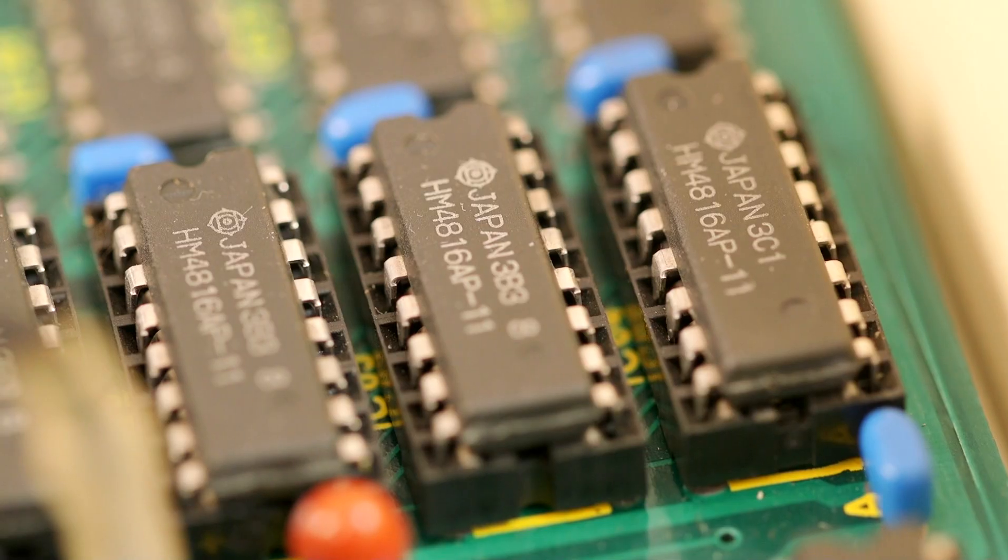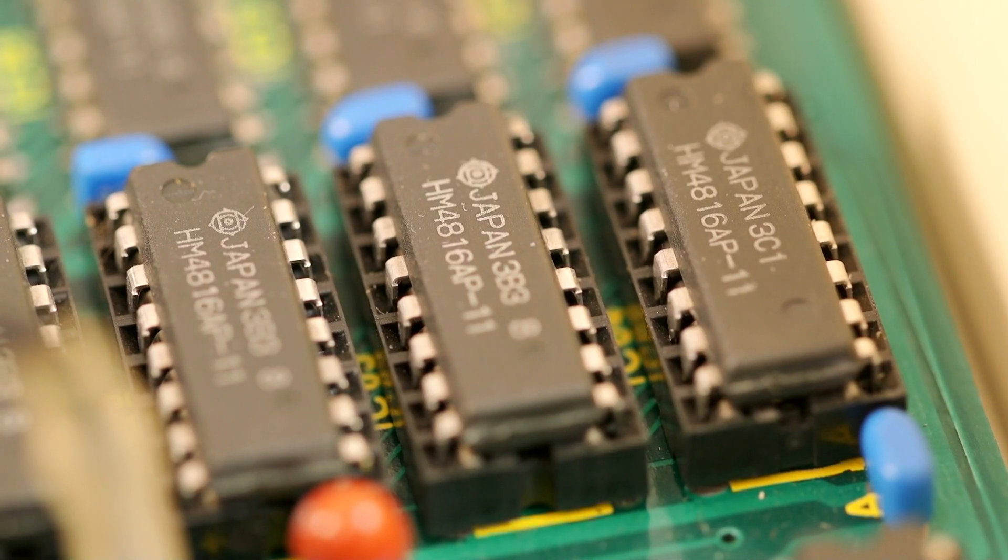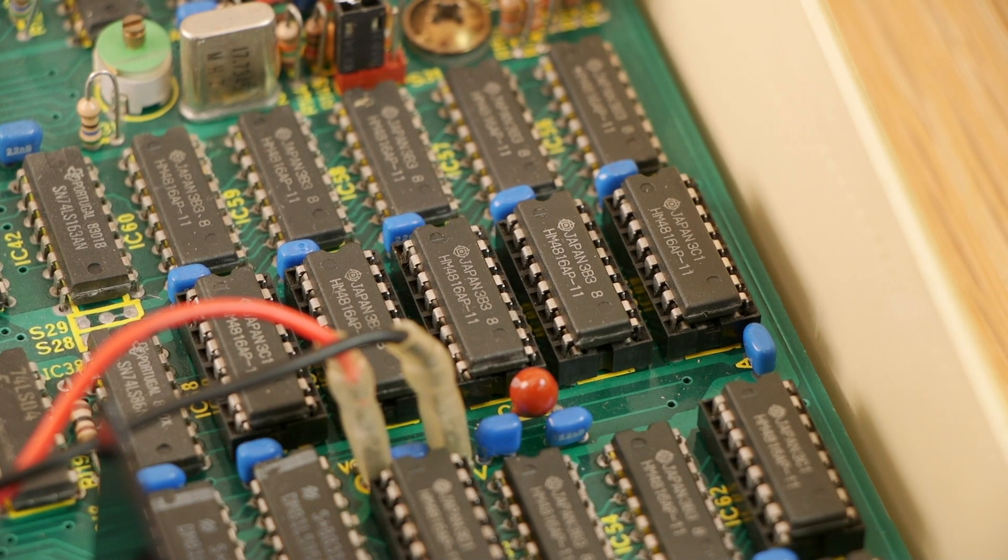It had one RAM chip which was a little bit dud — I don't know if it had a row or a column, I guess probably a column of bits with a dead sense amp. So you had some predictable locations in memory that didn't store the right value. If you displayed a high resolution screen, fortunately it was quite high up in memory where there's mostly just graphics, and if you put a white screen up you'd have a little barcode of dead bits in there. If you edited a large document in the word processor, you'd get corruption at predictable locations. I used to use it to do my schoolwork, and the last thing I'd do after printing was to go through the required places with a biro and put the correct letters into the text.